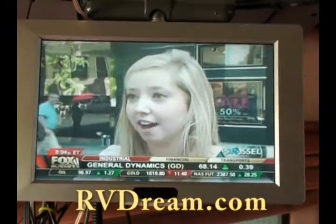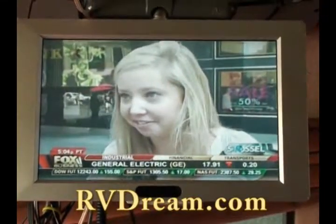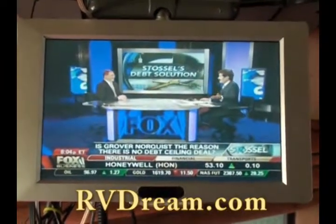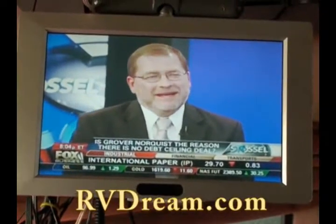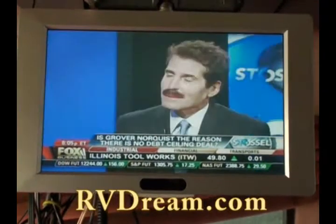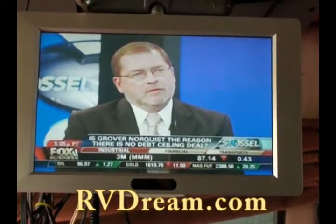A couple of real important tips. One of the things that really helped us was the Satellite Finder app. Once I got that, I had a better picture. Trying to find it with the included compass is so broad — you really don't know what you're looking at. Even with the good compass on the Droid, it's better, but the little compass they send you is not worth very much. It's a tiny little thing that gives you the general direction but nothing specific. The Satellite Finder really helped us most — it has every satellite, not just DirecTV. You scroll down and get the right satellite on there.